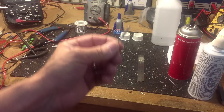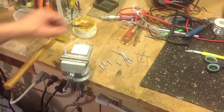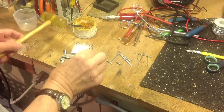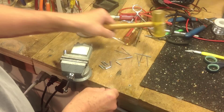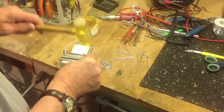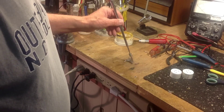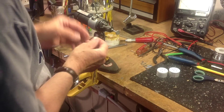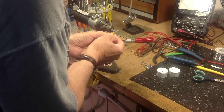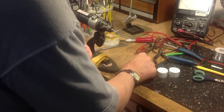We'll use 5/8 inch steel rivets for our connector pins. We'll drive out the mandrels and use the rivet portion for the pin, making sure we don't have any aluminum ones in there. The steel rivets have a coating, and we'll use a grinder to remove that coating and rough up the head of the rivet so that solder flows on and adheres well.